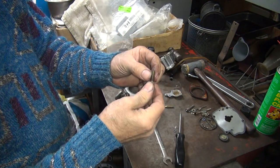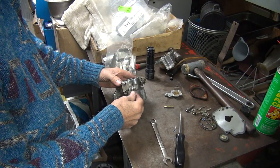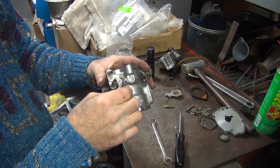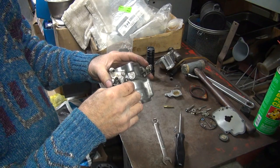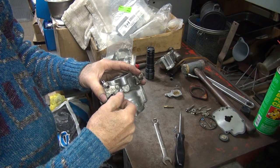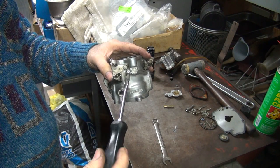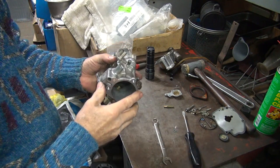So that's what this screw here is for — controls the idle mixture. Should be a spring on that. There's the spring; the spring keeps it from unscrewing. Cleaned off the tip here, all the muck off of it, so that should make it flow good — nice even flow rate as you play with it. Just go down until it lightly bottoms out, right there, and screw up half, one, one and a half, one and three quarter — good starting point.